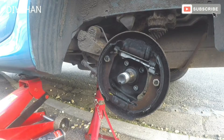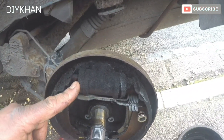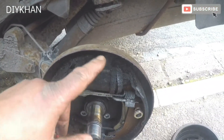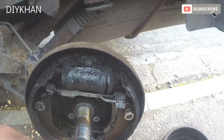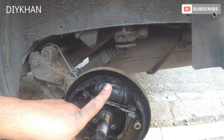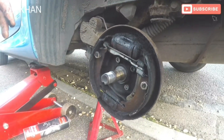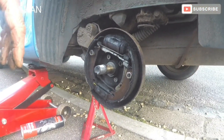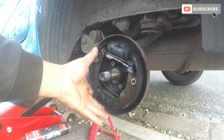The condition of the brake shoes on this car - they look all right, so it's just the hydraulic cylinder here which is leaking oil, as you can see. It's leaking really badly, that's why it failed on MOT. That's what we're going to be changing - we got the new ones for £15 each.